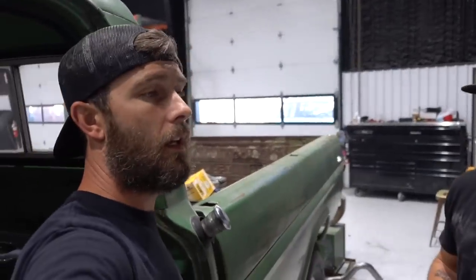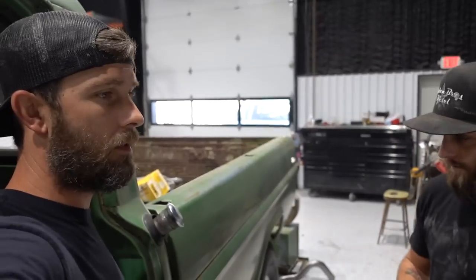Yes. So I learned two things. One, you almost can't get the gas vapor out, so expect a fire if you're at home. Yep. And make sure that you're somewhere where someone can put you out. Be afraid. Gas vapor, whenever you get a big giant hole in it where it can actually draw oxygen into the tank with the fuel vapor and stuff and ignite, that's when it becomes dangerous.